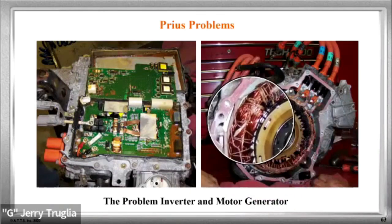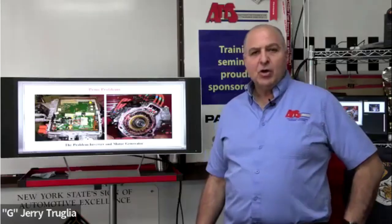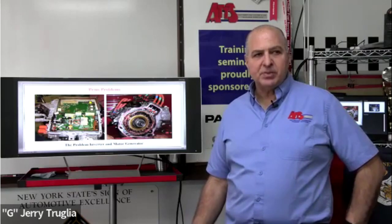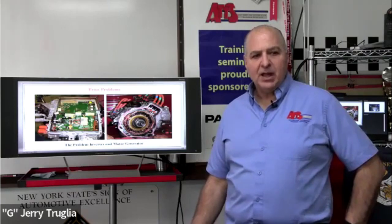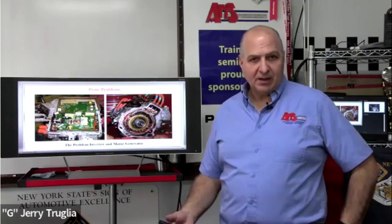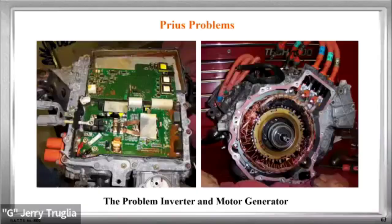This vehicle, rather than being all copper like that, it shorted out. Never ever use a hose or a pressure washer or any type of cleaner on these vehicles. You would have to make sure the car has been depowered down for a while. Then what you would need to do is clean it dry — you do not use any chemicals or anything on it. Any leaks are not good.